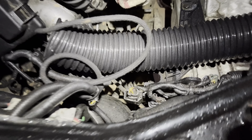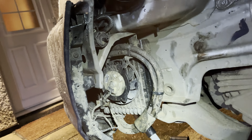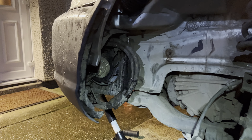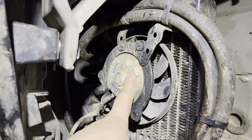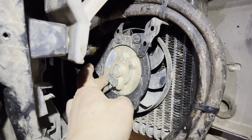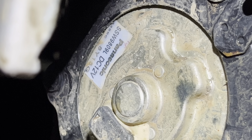So that's the auxiliary cooler for the transmission — that's how it looks, and all of that hides behind the arch liner. The fan is from a bike radiator. The radiator itself is from a Mitsubishi Delica — it's Denso brand. The fan is Panasonic brand; I might have a part number for it — search by part number.